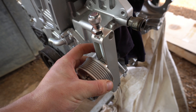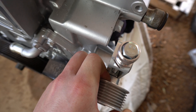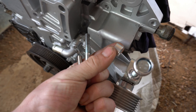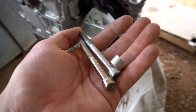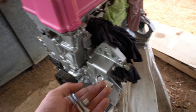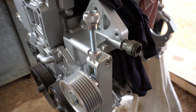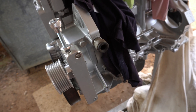Line this up just there. To get it to work you'll need to put in the provided spacers, but it really depends on what engine you have — I found a spacer that will fit. They give you a few different bolt choices depending on the model; I'm going to use the shorter one as I tried the longer one and it just bottoms out before it fully tightens. For the bottom bolt you're going to use the smallest allen key.